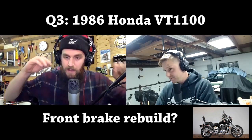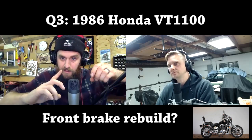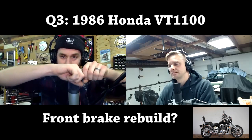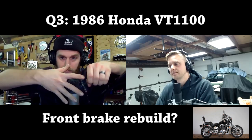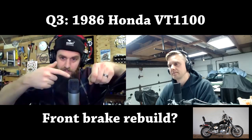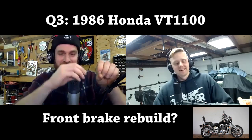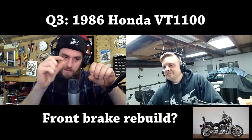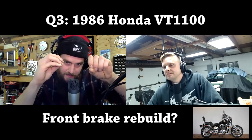But when that piston goes inside the bore, so when you actuate your front brake lever, it has a rod, Matt, on a little piston, which pushes down further into the master cylinder, which is holding your brake fluid. So you're kind of functioning this brake lever inside the hole. That piston inside is very close tolerance to the cylinder. So his is locked, right?